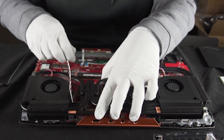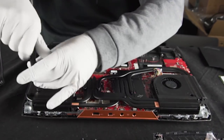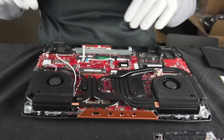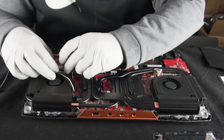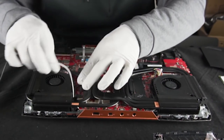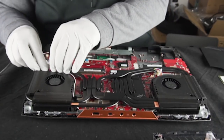I'm going to pull this all through here, try to line it up as best as I can before I drop it in. We've officially dropped it in. We're going to go ahead and secure these fans — the left fan only has the one screw, and the right fan has two screws. Now we're going to feed these wires back through, get the speaker connection, and feed these Wi-Fi wires into this little track over here — go one wire at a time, it'll make it a lot easier. Feed these under and feed this wire through here.